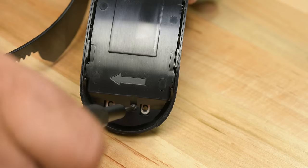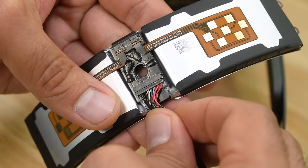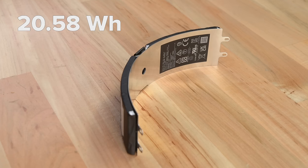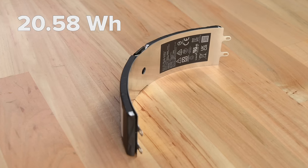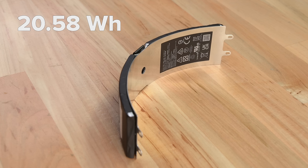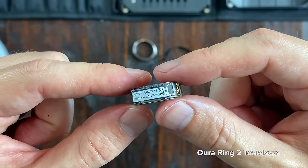As for the battery housing — surprise! One more plastic cover to remove here and a single connection cable. Disconnect it, and the battery is free. This twin-cell 20.58Wh battery is not only heftier than the Quest 2's single-cell 14.3Wh battery, it's also curved. Bending batteries is typically the last thing you would want to do, and while curved batteries are rare, we've seen them before. Placing the battery on the back of the headset is the key to the Quest Pro's world-class counterbalanced ergonomics — it makes the headset more comfortable to wear, and makes the battery easily accessible when you need to replace it.